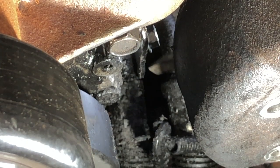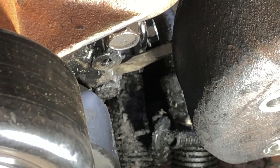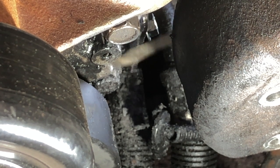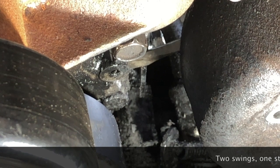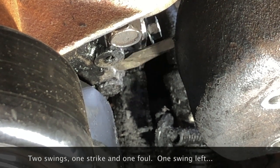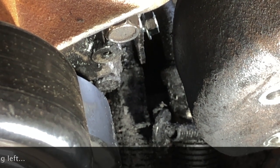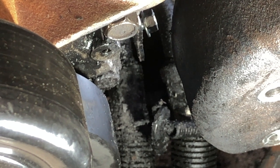All right, guys, the first screw ended up pulling out, but I put a bigger one in, and you can see we've got this pulled out a little bit more than 1/8 of an inch, and now that screw has given out. This stuff is just so old and brittle and fragmented. I'm only going to get one more shot at this, so I'm going to go to the next size up, and hopefully that does it. Otherwise, we're going to be disassembling the whole front to get the timing cover off in order to get this thing out. So let's see if we get lucky.